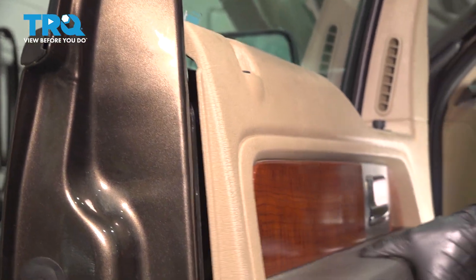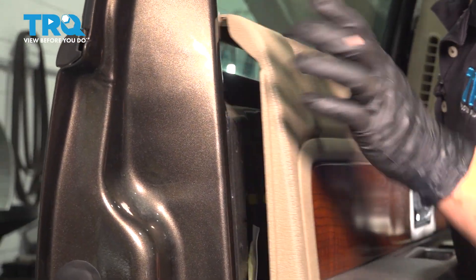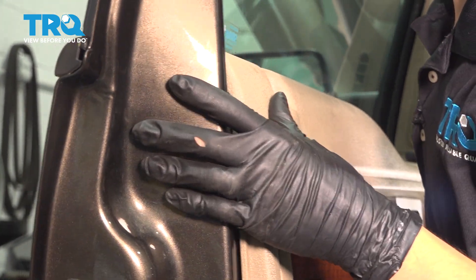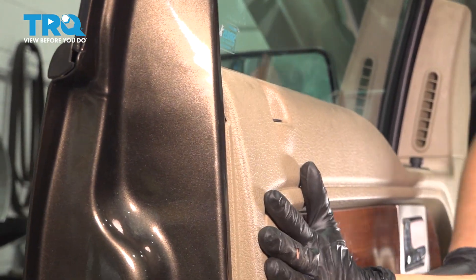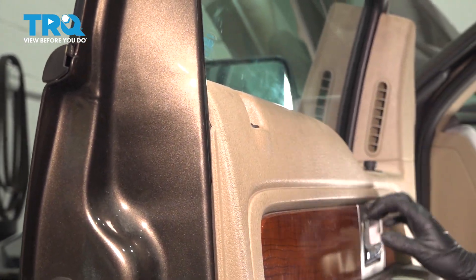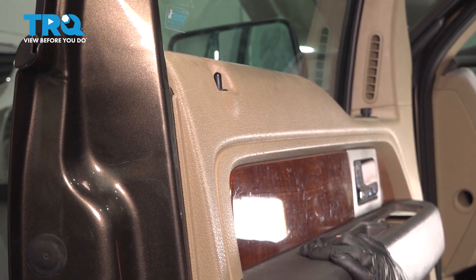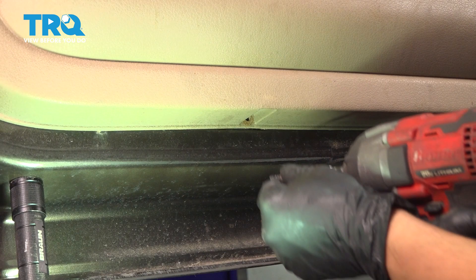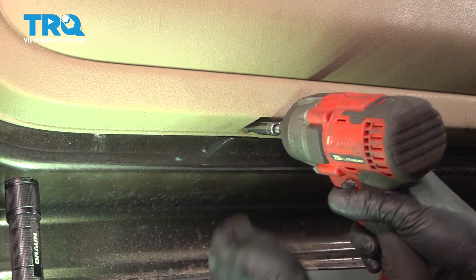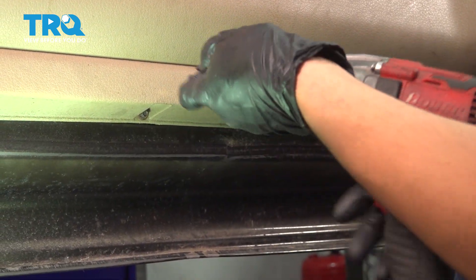Bring this up and press it up against the door. As it goes down, it has not gone through the hole yet — I can see it, it's lined up — press the door panel down. It was in the locked position, but if you just pull the door handle it should pop up and through. Now let's put the bottom two screws in. Don't tighten these up too much — they screw into plastic and are very coarse thread, so they will strip the plastic out easily.